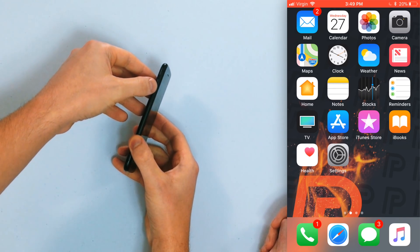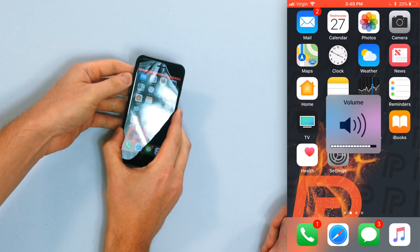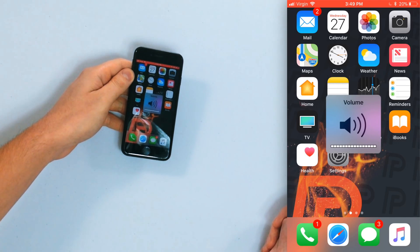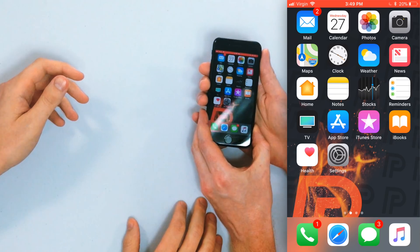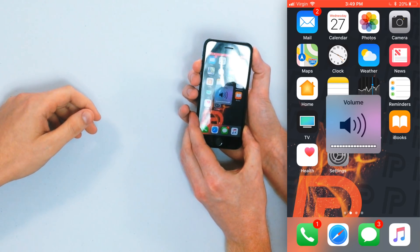If that doesn't work, make sure the volume is all the way up on your iPhone — just press and hold the volume up button and it'll zip right up. Also, watch what the display says when you do this. If it says 'headphones' instead of 'volume,' then your iPhone is stuck in headphones mode, which is a separate issue we have a separate video for. We'll link to that below in the description. If you're seeing 'headphones' and the volume slider isn't working, go watch that video.